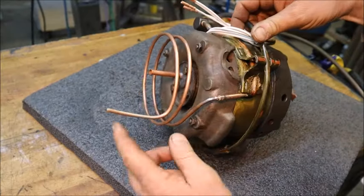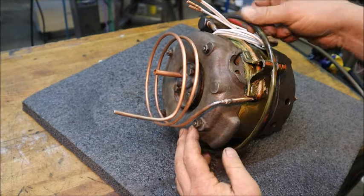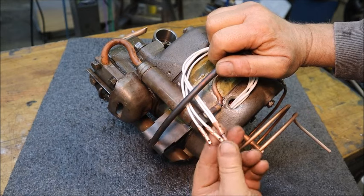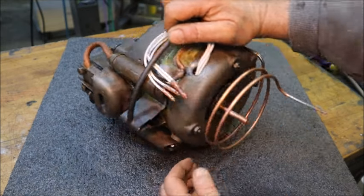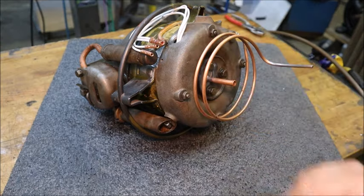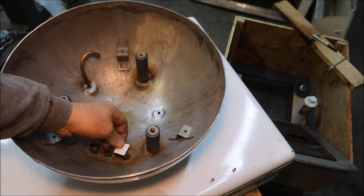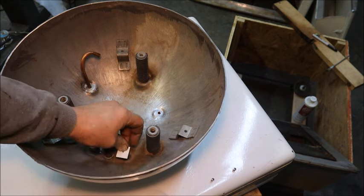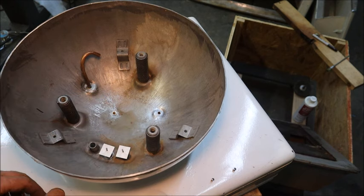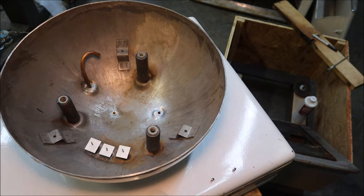The next thing I put on is this discharge line, and the reason it's formed like a spring is because the unit sits on springs and this has to have flexibility. I've also put some terminal fittings on the stator lead wires - those will solder over the pins in the housing, so I believe this is ready to set in the housing. These terminals had some paper washers on them from GE. I'm going back with some Nomex 410 paper washers - they're just cut out of Nomex 410 on a paper cutter, so they're going to have some square ones, but it is what it is.